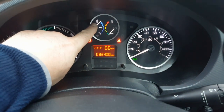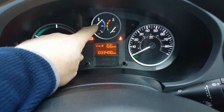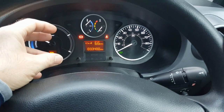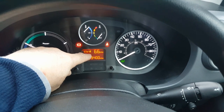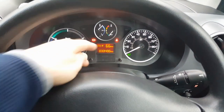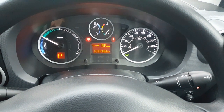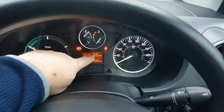This is your fuel tank — your battery pack — shown with a battery symbol. It works just like a fuel gauge: full, half, and zero. You've also got an estimated range, but this is very much an estimate. It's based on the current battery temperature and how you last drove. Cold temperatures do affect the pack, so range will be less in winter. Today it's estimating 66 miles, but if you've been driving at motorway speeds it predicts more of the same, giving a lower figure. You just have to take it with a pinch of salt — I know I can drive more than that even in this weather.